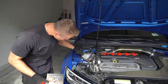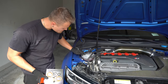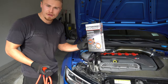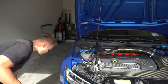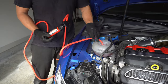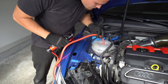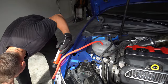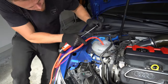The first step is draining the coolant out of the reservoir. We don't need to drain the whole car, just as much from the reservoir as possible since we'll be moving things around. I bought a Harbor Freight transfer pump kit for about eight dollars — any method or pump will work. The goal is to drain as much coolant from the overflow reservoir as possible. Once that's done, I highly recommend disconnecting the battery as a safety precaution.